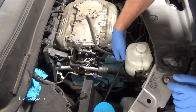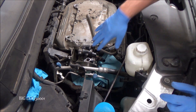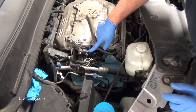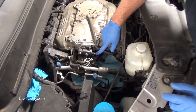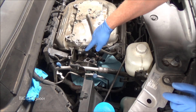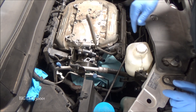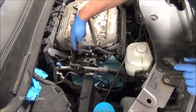I put a hood prop up so I can take the one attached to the vehicle and tuck it out of the way — hopefully you guys have a better view now. Now to get this pump out, we have to remove some stuff. The easiest choice in my mind is just to take this intake manifold tuning actuator out of the vehicle. There are just two hex bolts and we can pop it off and get it out of our way. We do have to unplug it first. If you don't know what this IMT is, basically there's a flap in there and all this thing does is turn that flap and divert the air.